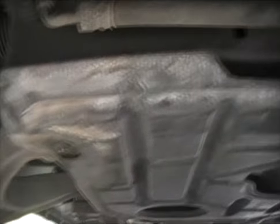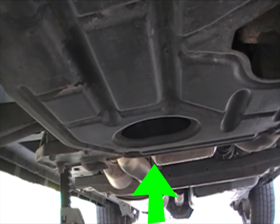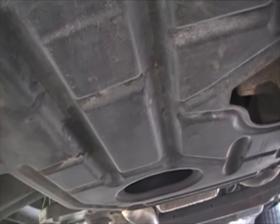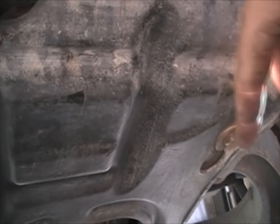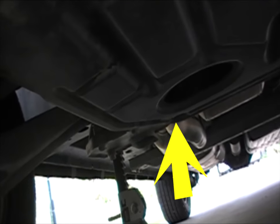Underneath the Jeep we have a guard — it's kind of a skid plate — and it's got a couple of bolts in it that we have to remove. Now, you can get to the oil filter right up there as well as the drain plug right there. But I've noticed that if you undo the drain plug right there, it will just fill this skid plate up. So it's a lot easier to take this off and put it back when you're done.